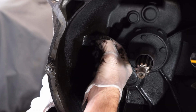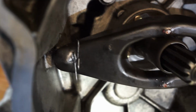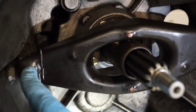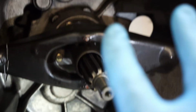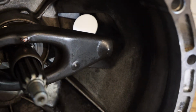Once you pry these two pieces apart, this little opening that it creates, and then you put the pivot arm in and it should slide underneath this clip here, but on top of the pivot ball on one side. This is the same either way, so I don't think you can mess it up left or right. The other side will go, of course, on the slave cylinder actuation.